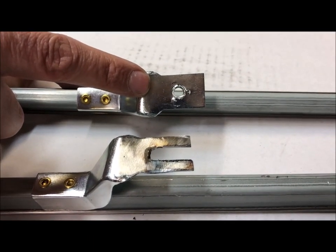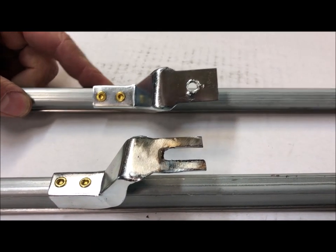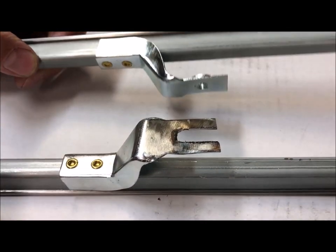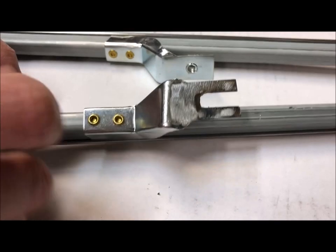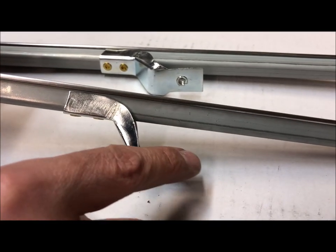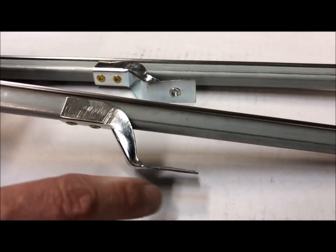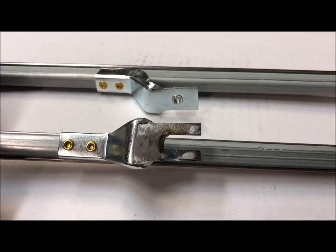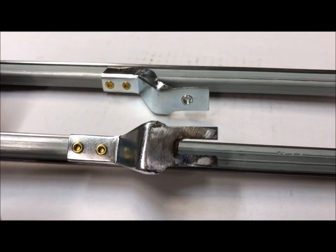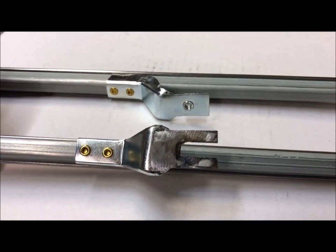This is an unmodified rear lower track. As you can see it has the welded nut. What I've done is marked lines creating a slot. I came in with a high speed cutoff wheel and buzzed the nut off, then cleaned up the surface so there were no burrs. This allows the lower felt to slide between the upper door frame and the shell.